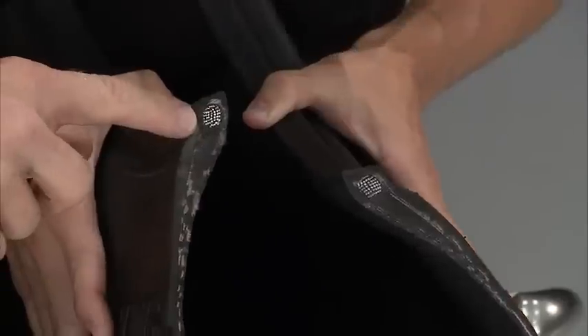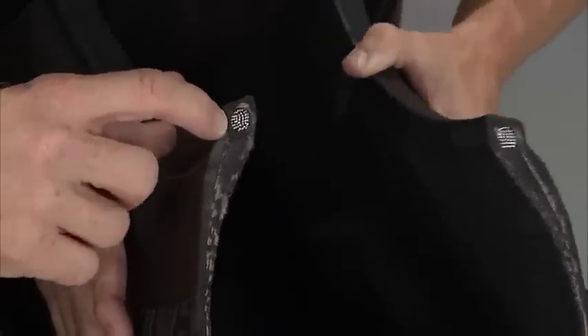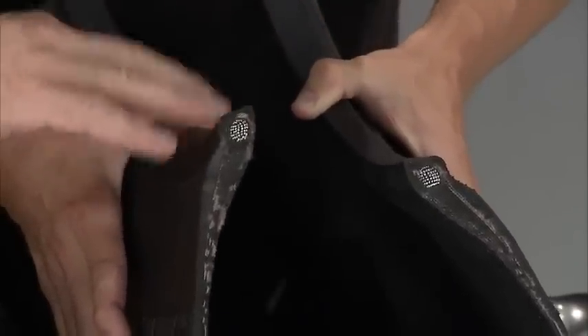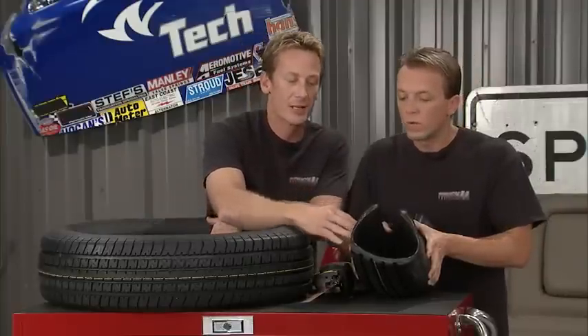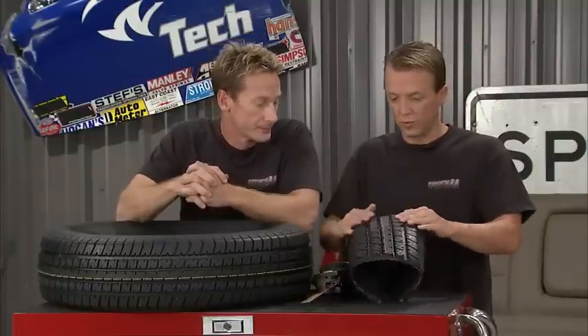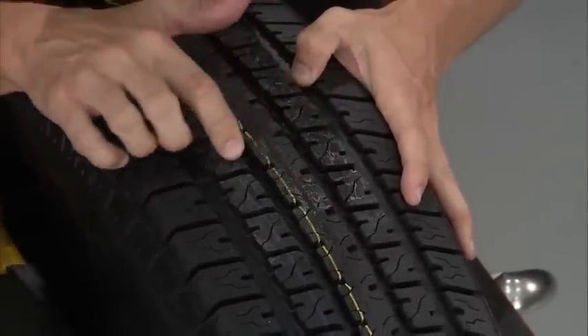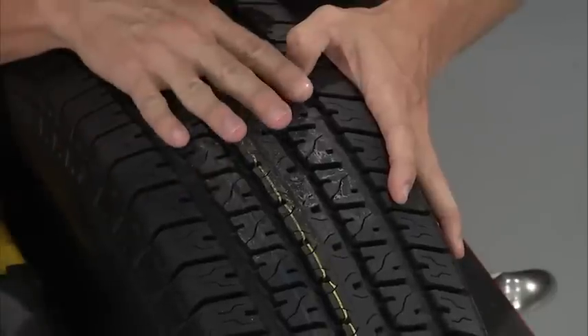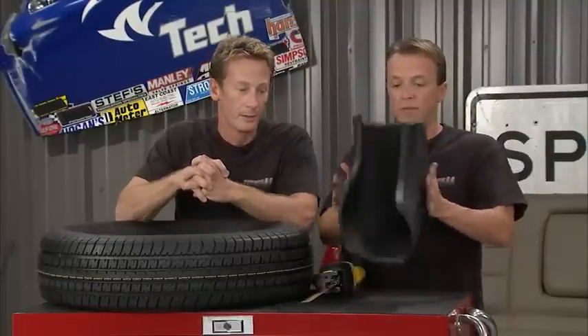Take a look at the bead right here — you can see all these steel wires, probably about twice as many as you'd see on a truck tire. The whole idea is to keep the bead nice and stiff, keep it hooked to the tire and the wheel, which is obviously pretty important for trailering. You want a stiff sidewall so the trailer doesn't wash out or roll on you when going around turns. The shoulder treads on the side and the middle grooves are engineered to evacuate water off to the side, keeping that contact patch between the tire and the road as large as possible.